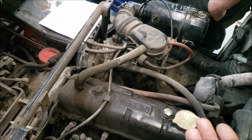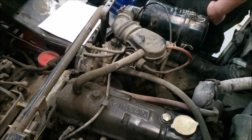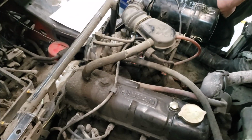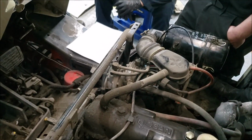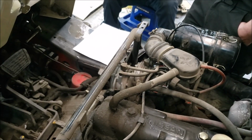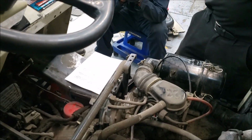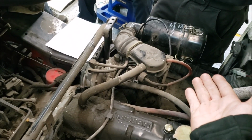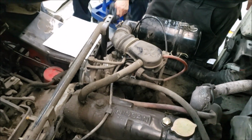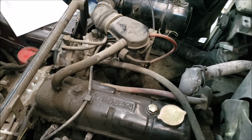But if I see less than that, then I have a problem with high resistance, electrical wise. But if I see a high current and the voltage drops, then I'm looking at mechanical resistance. Because the higher current tells me the battery is trying to supply the current. I have no high electrical resistance because the current was able to pass through. So it might be a mechanical resistance in the starter or in the engine itself.